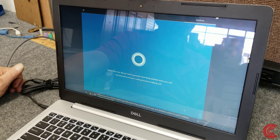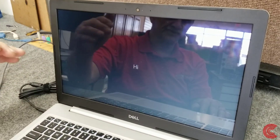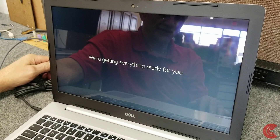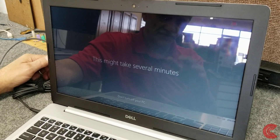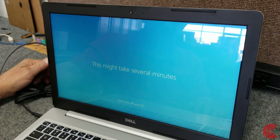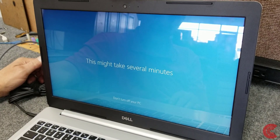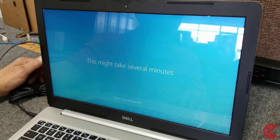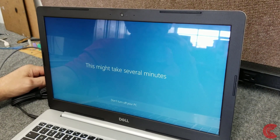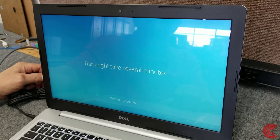Almost done — Windows is finishing up. Once you're into Windows 10, this is the 1909 edition. Go into Windows Update, run it, get all the cumulative and important updates through Microsoft, reboot two or three times, and update your Store apps. You don't need a Microsoft account for any of that. Then go to Dell's website, click Support, put in your service tag or model number, and download any necessary drivers that Microsoft didn't install.